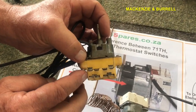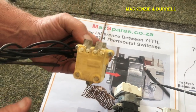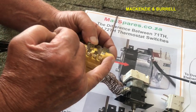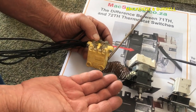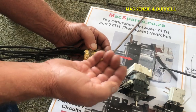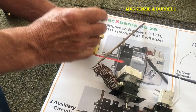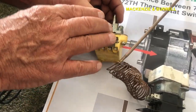Now the granddaddy of thermostats — if you look at it, there's a multitude of terminals: one, two, three on one side and one, two, three on the other — six terminals total. It's a very expensive and old thermostat. You've got one set of connections for your grill and another set for your bake element. What this one does is bring your grill and bake elements in together to heat the oven quickly, then between 15 and 30 degrees below your set point it switches off the grill, and the bake element brings you to your set point and controls from there.